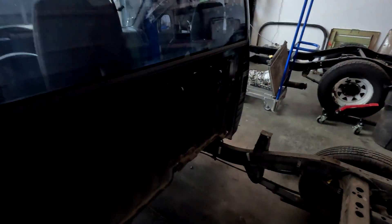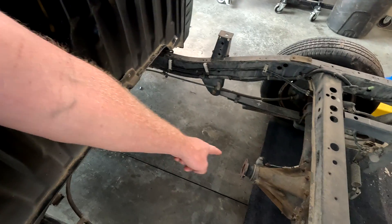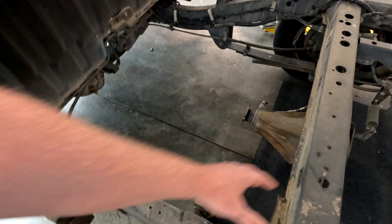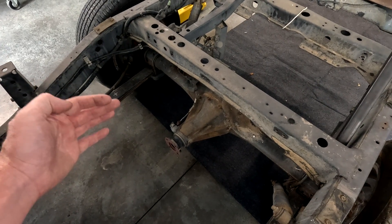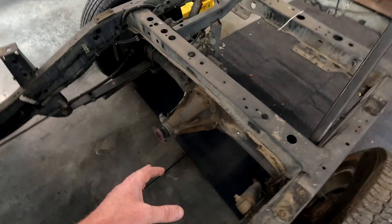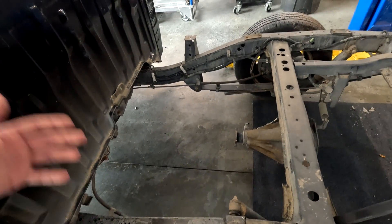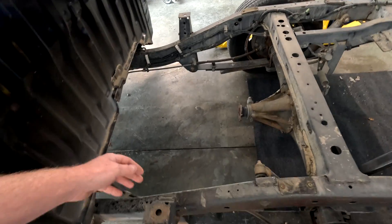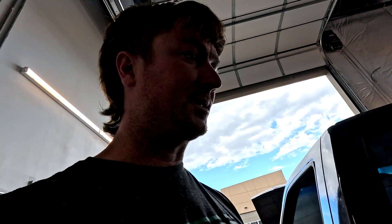We've got a lot of space here. Now it's pretty tempting to say let's put the battery there, but you've got to account for the drive shaft, because the drive shaft is going to come through the middle and cut this area basically in half. So depending on the size of the Leaf battery, we may be able to fit it on one half or the other half. The differential is actually offset to the passenger side a little bit, so it's not dead center. The logical place would be the driver's side, but that's where the driver sits. Ideally you'd have it on the opposite side to counteract the driver's weight and get better side-to-side weight balance. The battery may end up being too big for this space anyway, and we'll have to split it into two halves — electrically connected but cells on this side and cells on that side. We'll just have to play that one by ear when we get the car and start designing the battery box.